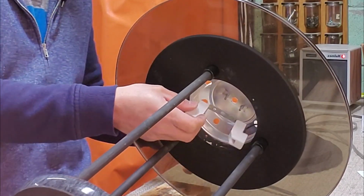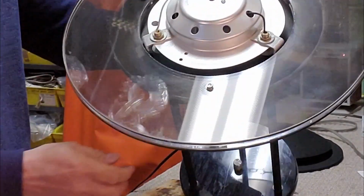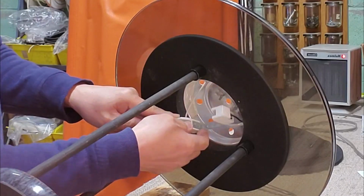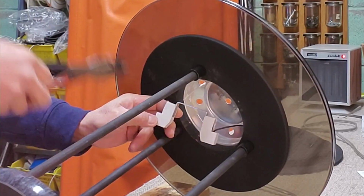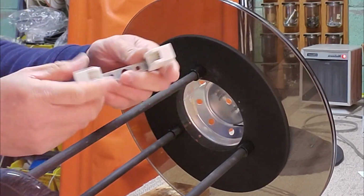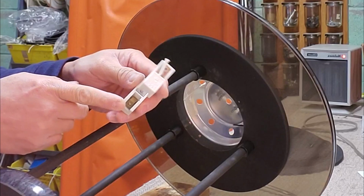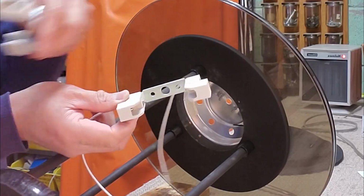And pull the socket. Then cut the wire from the socket. The common problem of this socket is the contact become corroded over time because of the heat of the bulb. The length of the bulb of this socket is 78 mm.